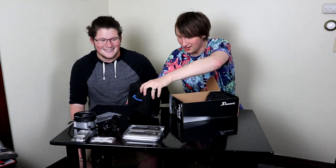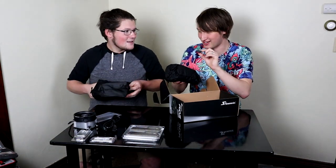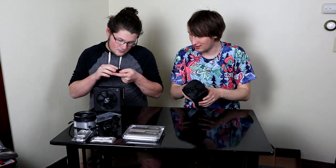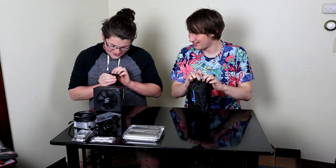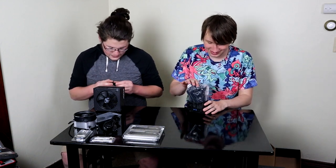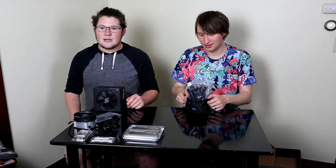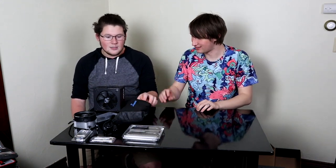That's at home. Okay, so if you want to open that bit up, what's this? Is it a protector? That's a right angle adapter, I believe. Or no. They have a Seasonic too. What the hell is this? I don't actually know. Looks like a loopback piece, so that if you want to use multiple power supplies in the same computer, this will turn the power supply on itself. And then this is all just cable. A connector that has a jumper built into it. I've never seen one come with a power supply before. That is really cool. Didn't know that was a thing. It's so that if you're using multiple power supplies in the same computer, it automatically starts that one up.